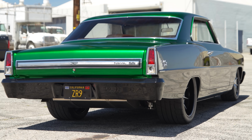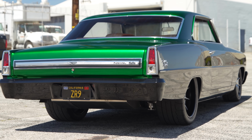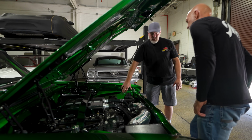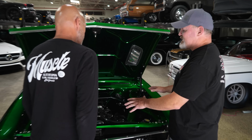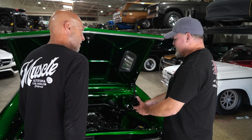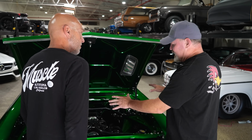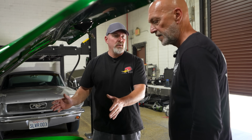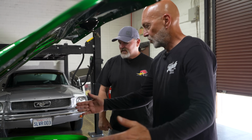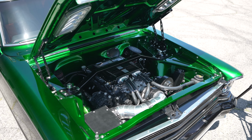What did you do? Did you do a full chassis on this car? Nope, it is Church Boys racing suspension, front and rear. It keeps the sheet metal inner structure, which a lot of people don't like. It's weak, it's this and that. But when you beef it up, Church Boys uses Detroit Speed rack and pinion, and they use all their billet arms, and they get all the geometry correct that these cars are always built wrong. Gotcha. So they've taken all the crap out of it. But it pushes it all this way with the towers and stuff, so you've got to...